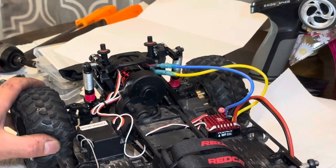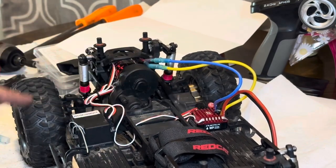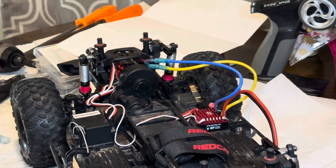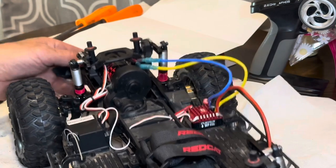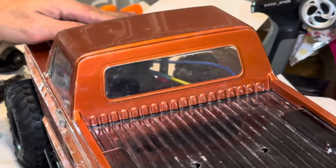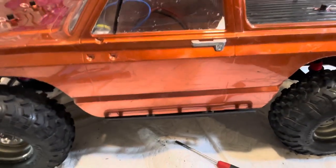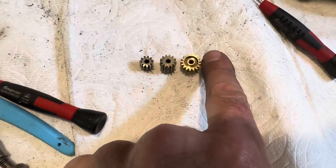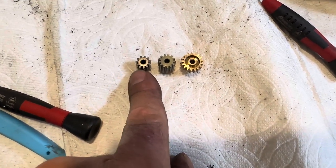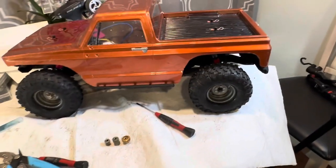That should make the drag brake look better with the lower gears. It's got the 1080 Hobbywing ESC, and the 13-turn 5-slot Holmes Hobby motor. I installed a 12-tooth versus the stock 17-tooth. 13 is all right, 11 is pretty low geared — we put 12 on there, and it should dramatically help with the crawling.